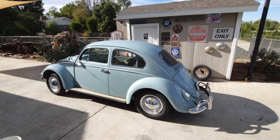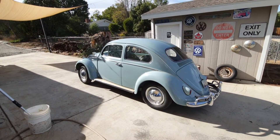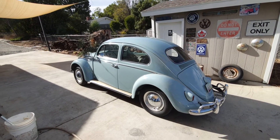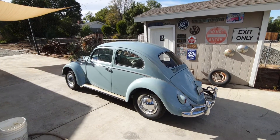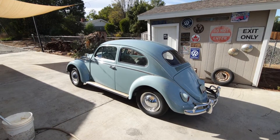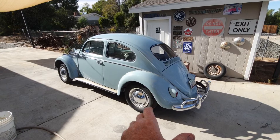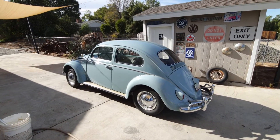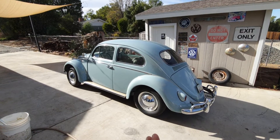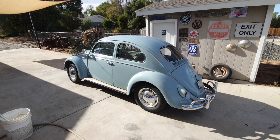What it's like driving one of these is kind of nice — the higher RPM means you seem to always have power. But your top speed is maybe 75, and cruising at 75 the entire time is not good for the engine. Stock VW engines without cam or carburetion upgrades don't like to rev much higher than 3,500 RPM. Get into 3,800–4,000 RPM and the engine will run hot, so keep that in mind.